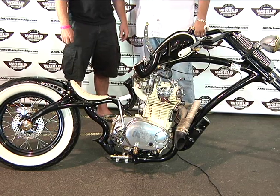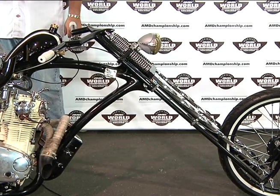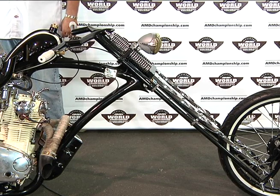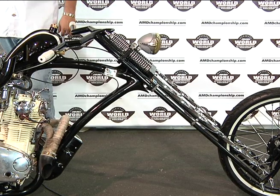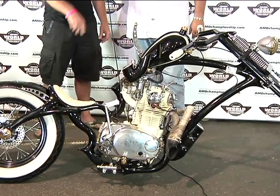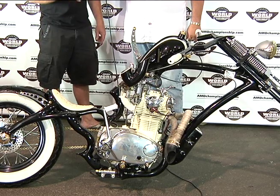So what's your frame geometry? The rake — you're looking at about a 42-degree rake. About 3 inches of ground clearance. I do a lot of riding on it, but it's by no means a commuter bike. It's an 18-inch over front end, with a drop seat. As you can see, the tanks actually incorporate into the frame.